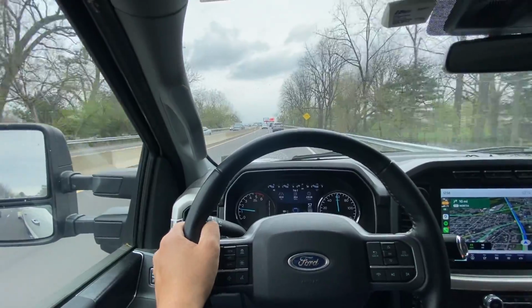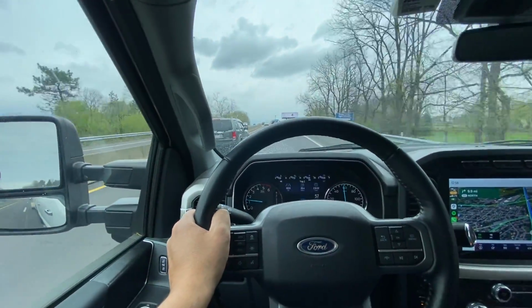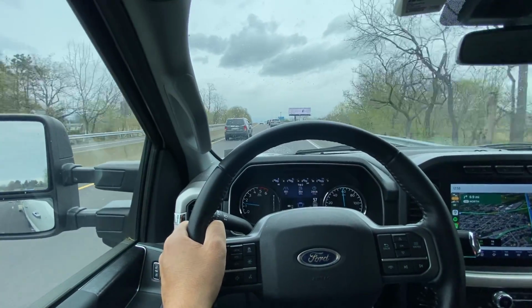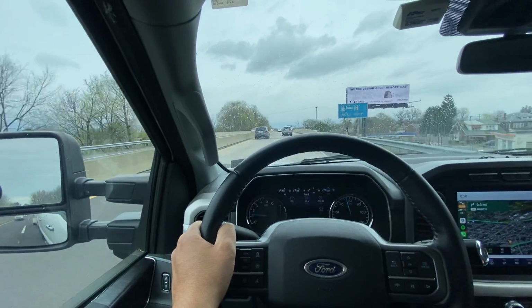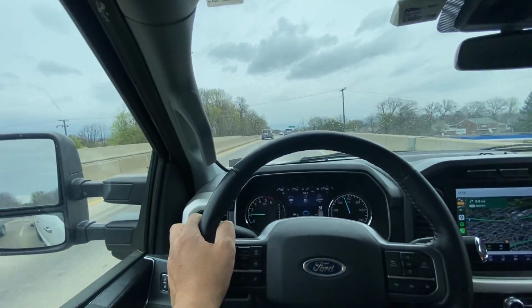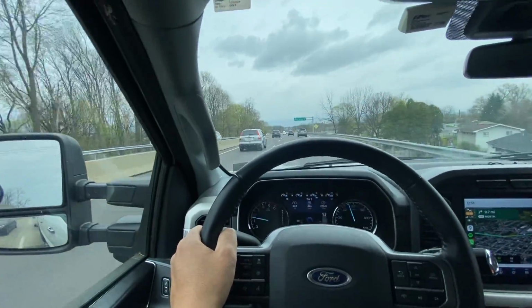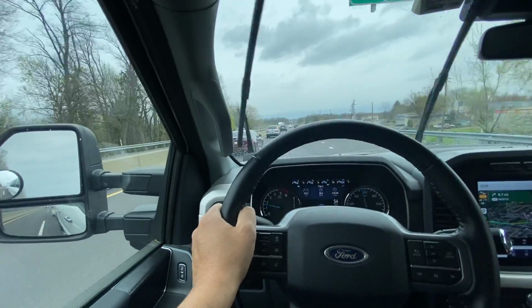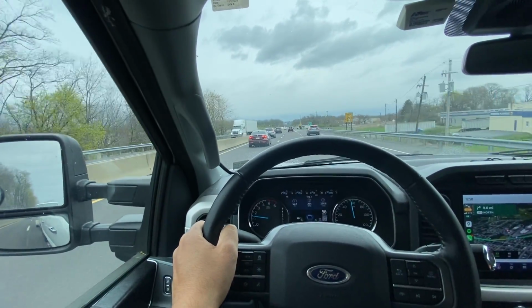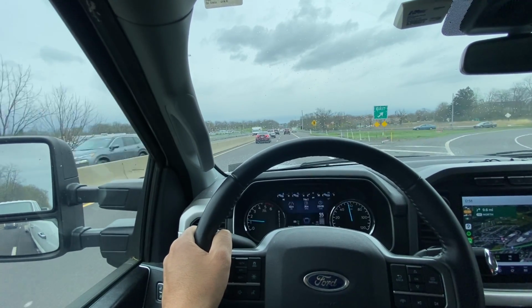And it might seem like we're getting way off track in terms of your final drive, but your final drive, or your axle ratio, plays into all of this. The lower the number of your axle ratio, like the 3.31 being a lot lower of a number than a 3.73, the taller your ratio. That's how it's described. And the less leverage your engine and transmission are going to have over your wheels. Does that make sense?